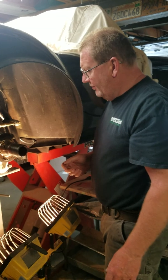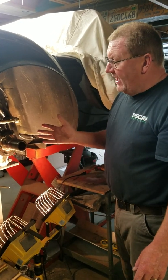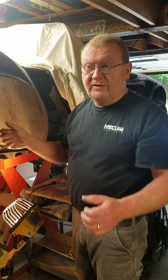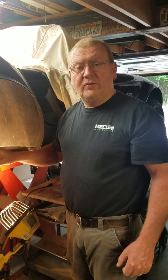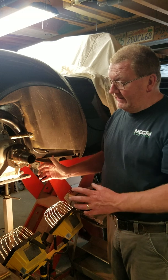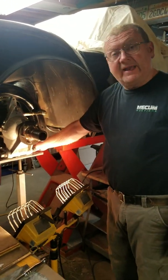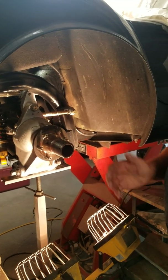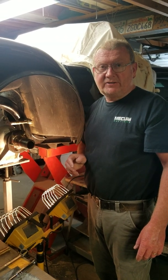This is a contemporary with a Jag independent rear suspension, and this Watts linkage makes all the difference in how the car puts power to the road — stopping the rear wheels from moving forward and backward under acceleration and braking, because there's a lot of rubber going to the road and a lot of forces on this rear end. If you add our triangular gussets on the lower control arms, you'll have a pretty bulletproof Jag rear end in your contemporary Cobra. You can see all the parts and hardware on our website. Thanks for watching.